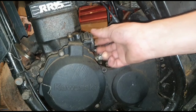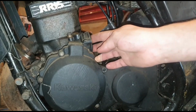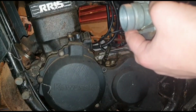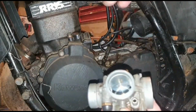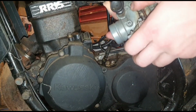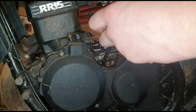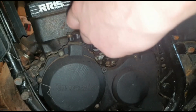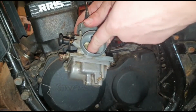That's another thing. There is a groove, right? It's a funny shaped one. There is a groove for it, so just remember, it only goes in one way and one way only. I'm not going to investigate that until later. Literally, like I said, I just want to get it running, make sure it does what it's meant to do. If you look in there, you can see there's like a notch. And obviously there's a notch in here as well, so we'll get that in there like so. Just make sure it goes all the way to the bottom. If it fights, you know there's a problem. If the spring pushes up against the top of the carb, again, you've got a problem. And if the throttle slider is stuck upwards, again, problems. But nice and snappy.